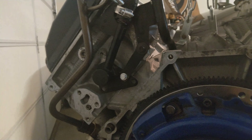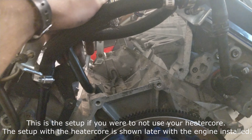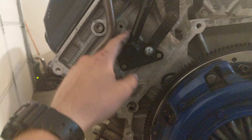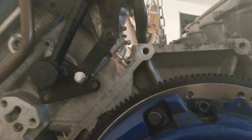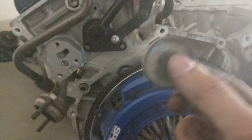The problem is on the back you'll usually have this one coolant line coming from the head and it'll flow up and go down into your water pump. On the other side there won't be anything whatsoever and the coolant will just deadhead right there and sit and not cool that side.